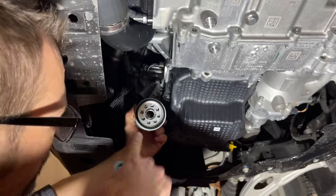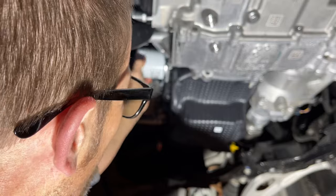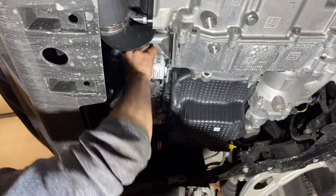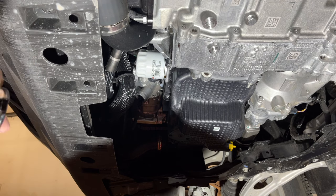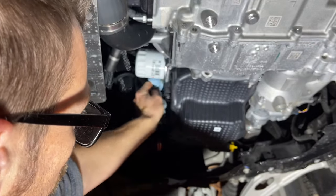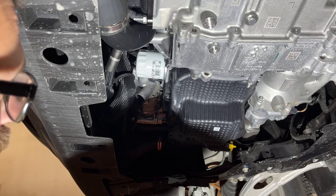We've got a new filter with some fresh oil put on the gasket. We'll spin it on and tighten it down pretty tight. I used to be annoyed with filters that were on tight, but one time on my own vehicle I went to change the oil and the filter just spun right off — I hardly touched it. That scared me, and I thought I'd rather have to put a filter wrench on it than have a filter fall off and ruin an engine because I lost all the oil cruising down the highway. So I've changed my tune on that. You don't want to put a wrench on it to tighten it, but you can go pretty tight by hand and just reach for the filter wrench next oil change.